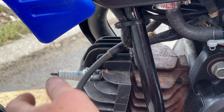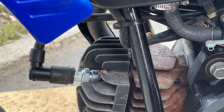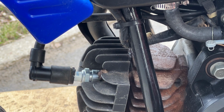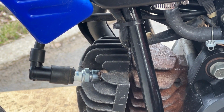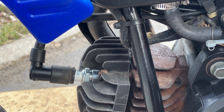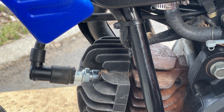Okay, it's still in the start position. Fuel is on. Don't know if fuel is getting to the carburetor. Actually, let's just check that first. I haven't even bothered to choke. But let's just open the petcock float bowl on the bottom and see if any fuel. Is there an overflow down there? Yeah, there is. Oh, yeah, there's fuel. We have fuel. It's not stinky. And someone's put a Tygon line on here. So someone's played with this at some point.